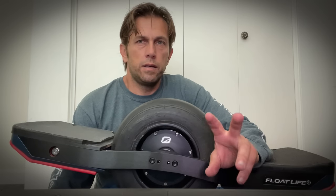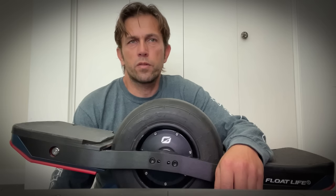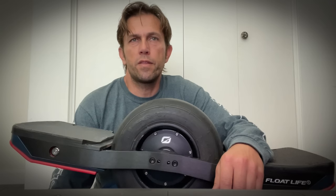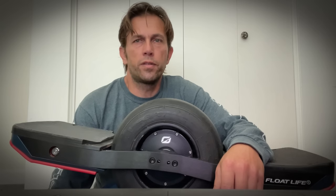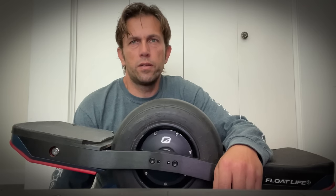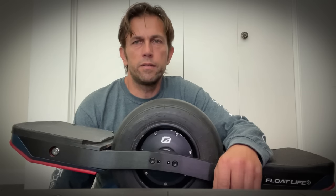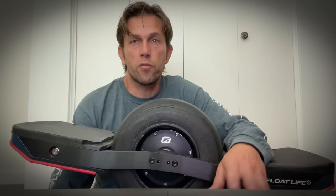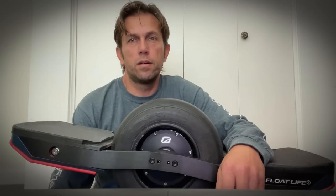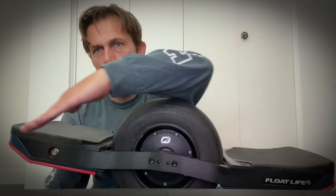Long story short, I eventually introduced ATR, which stands for Adaptive Torque Response, and that originally started out as a 5.3 feature called Torque Tiltback, where high amps lift the nose. The inherent problem with Torque Tiltback was that any amps would lift the nose, but if you're accelerating, you don't want that to happen. People like that when they accelerate, you want to be able to do a nose grind if you really push it hard — keeping that natural acceleration feeling where your nose really goes down.